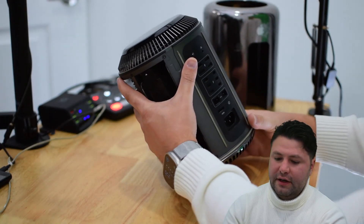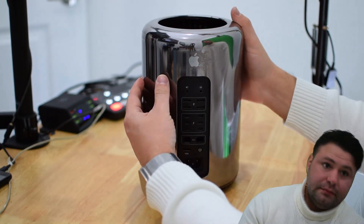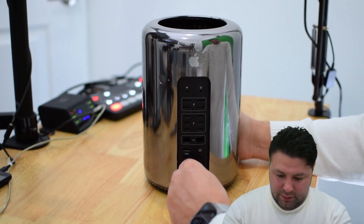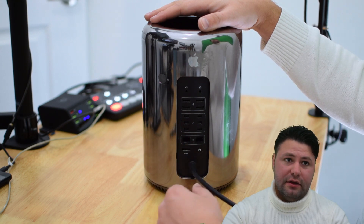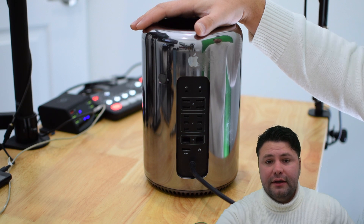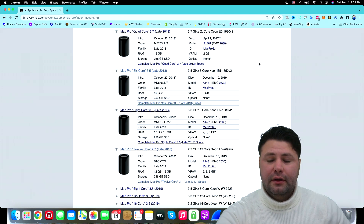This is finished and it has the new memory inside. Reassemble by putting the cover back on, lock it in, and plug it up. Let it power on, then go to About This Mac and click on Memory to make sure the slots are showing the upgraded memory. I'll link memory upgrade modules in the description so you can check them out on Amazon or eBay. For further information, I highly recommend going to everymac.com, finding your exact unit, and looking up its specifications. Thank you for watching.